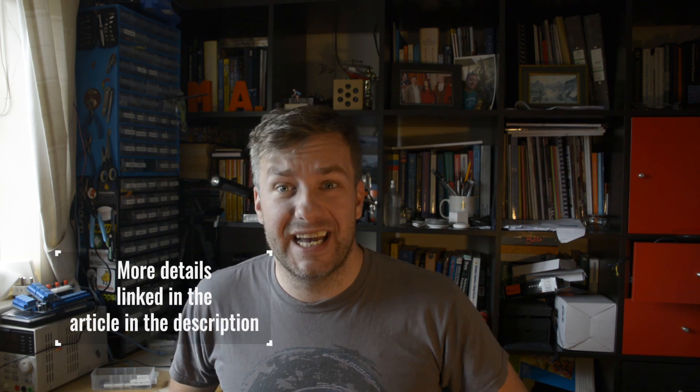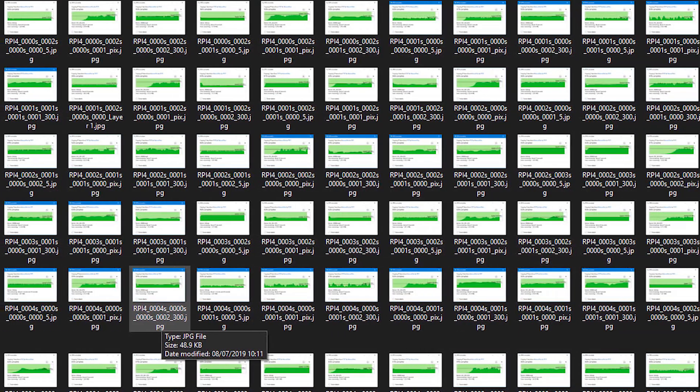Unlike last time, I'm not going to use iPerf to test the network throughput — I'm going to use some real-life tests. I was crazy enough to perform 154 separate tests, reads and writes for three different file types: a 300MB single file, done because it needed to be smaller than the RAM of the smallest board (Raspberry Pi Zero); 55 files equivalent to 300MB; and also a 5GB zip file, mostly to oversaturate the RAM and keep results consistent — something I really regret doing now because I had to transfer that 5GB file across every board.